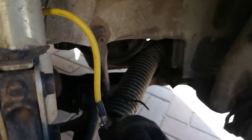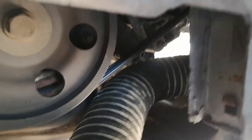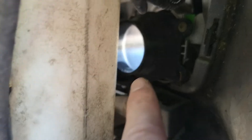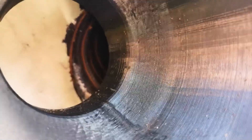The driver's side is a bit better directed - you can see it's pumping straight at the back of the disc. But it's had a bit of a journey and looks like it's flapped around a little to rub on there slightly - not rubbed through, but not ideal. The problem is the washer fluid bottle is in the way. Oh, it's come off - well, that's not good. The pipe should be attached here and go down that tube.